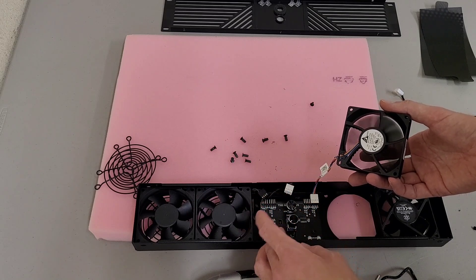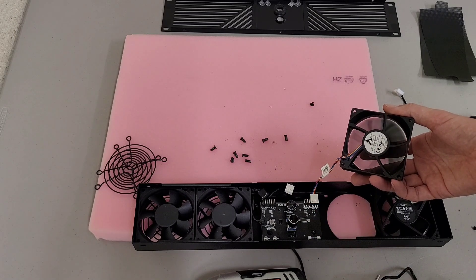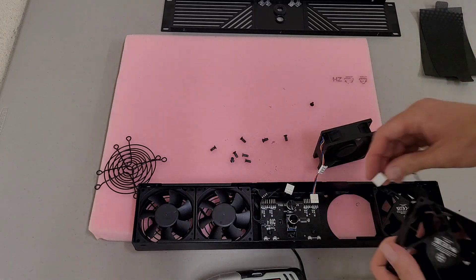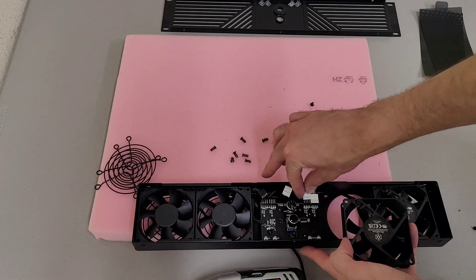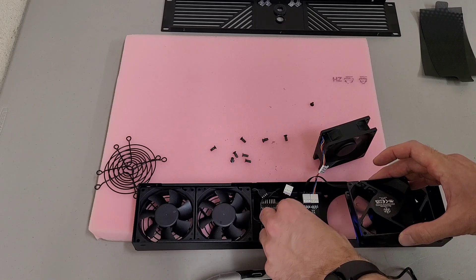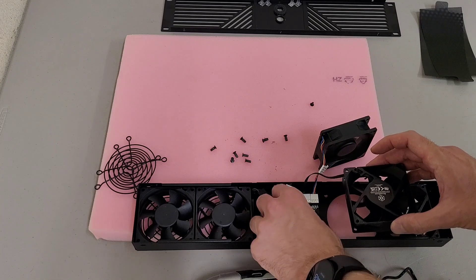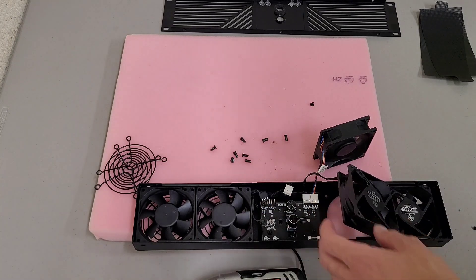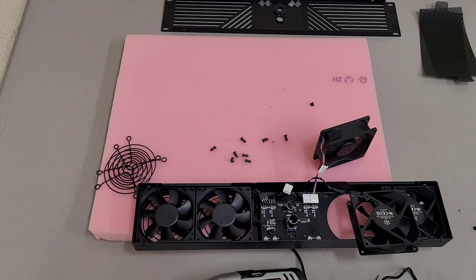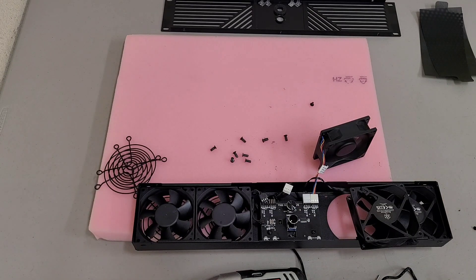Fan swaps may or may not be a good idea depending on the fan you use. The fan was still spinning even after shutting off, which was a bit strange. But just messing around there at the end. Hopefully that was helpful. To put it all back together is just the opposite steps: screw the PCB down with the four screws, screw the fans in to hold them in place, and then use the Allen wrench to screw the faceplate screws back in. Hopefully that was helpful, and thanks for watching.